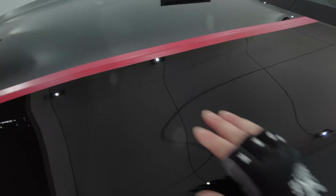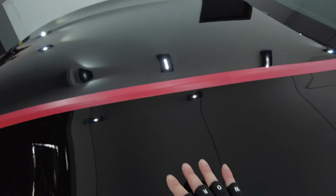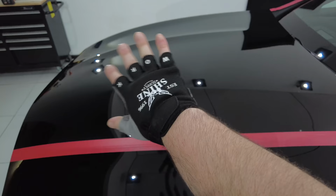The defect removal was what I'd say about 80 to 85%, and the finish was almost perfect apart from just the tiniest bit of haze that I'm sure I'd be able to eliminate by just tweaking my technique to maybe add a little less compound or switch to a smaller 15mm throw DA polisher. But here's the thing. When you decrease aggression to improve the finishing quality of a combination, you also, at least to some extent, decrease the cut or defect removal. And since I still need a little more cut to reach my defect removal goal of 95% plus, this combination just wasn't going to work.